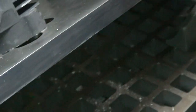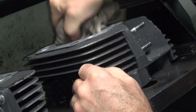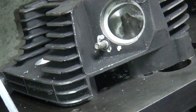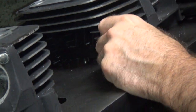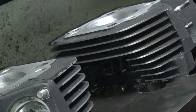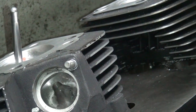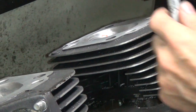When it goes off the edge of the valve, that's when my angle I put in here catches that on the other side of the air flowing and turns it around. It makes a nice curve and makes it flow out into a nice funnel shape — and that's where the power comes from. That's more important than any port job, because that's the last thing you control — what goes into the chamber. And that's what the porting guys won't tell you. It makes more difference than anything they're doing. You've got to seal too — if it doesn't seal you've got no power. So you've got two things you've got to do: seal and straighten the air flow out and make it flow correct.